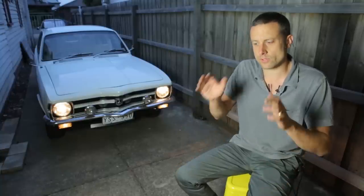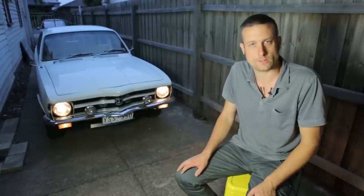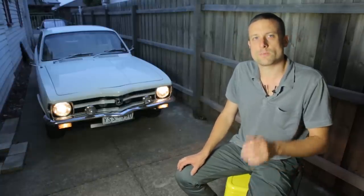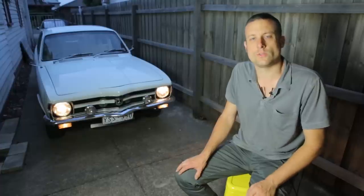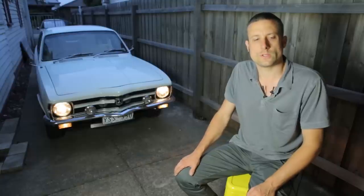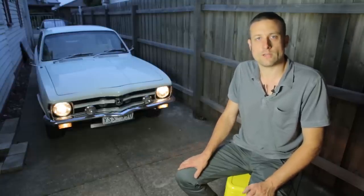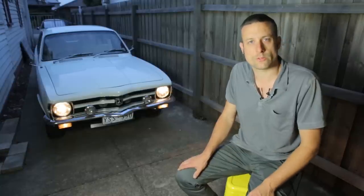When I came out of the molasses, I thought I could just work on the rusty areas and the primer would protect the clean steel. The epoxy primer — I brushed on two thin coats and left it to cure in the garage with no heat. It was winter in Melbourne, I gave it between two and three weeks.